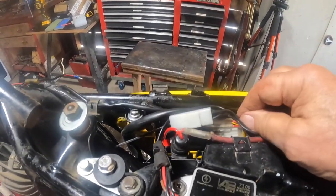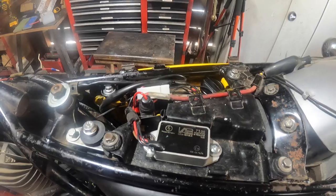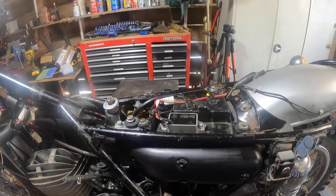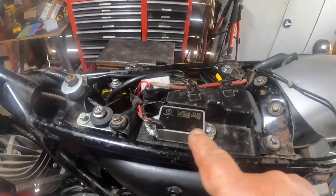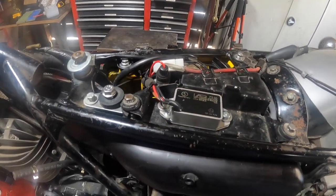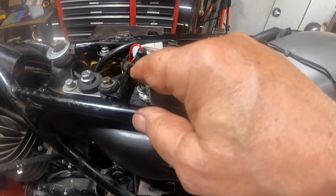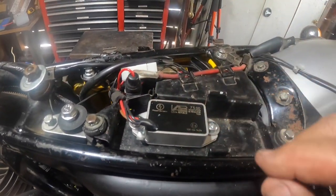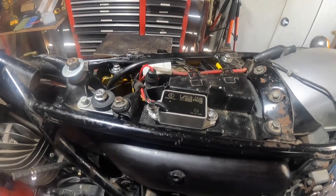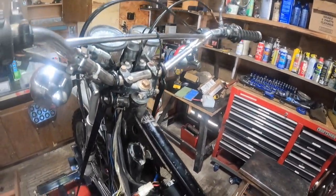All right, these kind of pack neatly down in here because the battery that's in there is just a little tiny thing, 1.3 ampere hours. But it does make the headlight turn on very bright. It won't do it for long, but if the engine's running, then you got these two black wires coming up from the new stator down here, and they have an AC voltage on them. This little box rectifies that AC voltage and sends it on this red wire over to the battery to charge it and to provide extra electricity or current to the headlight and the indicator lights and all that.